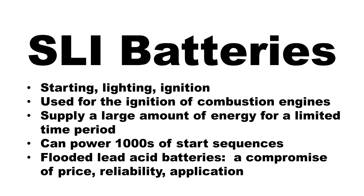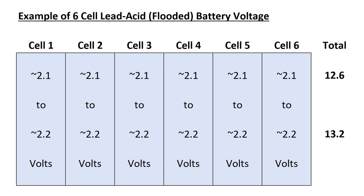A 12-volt battery consists of six interconnected cells in series, in which the rated voltage is approximately 2 volts for each cell. The battery casing is made of plastic divided by separating walls and connected in series by cell connectors. This is important to remember because when the voltage is predictably low, say 10.5, that means one of the cells has probably gone bad.